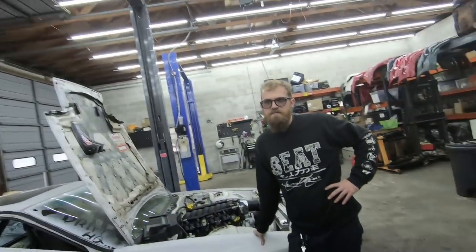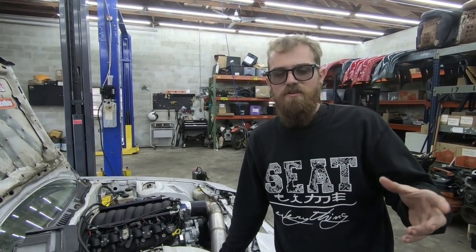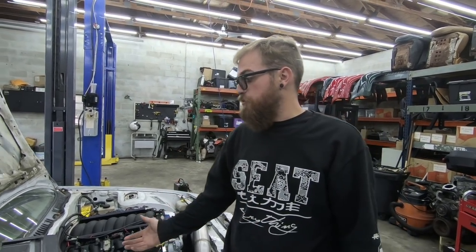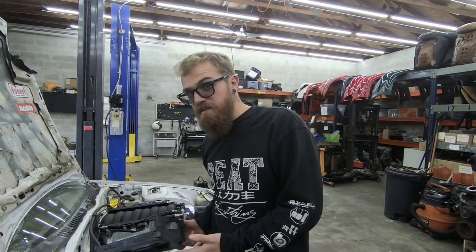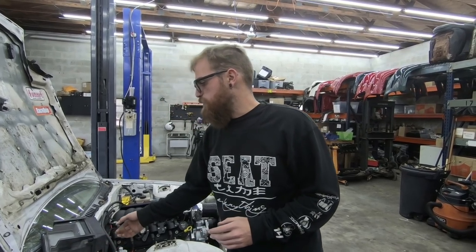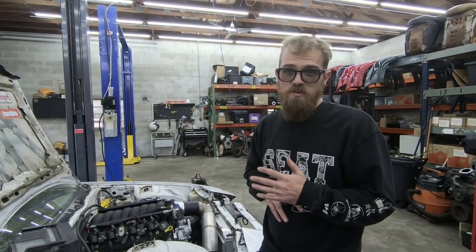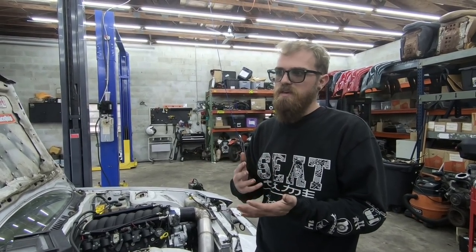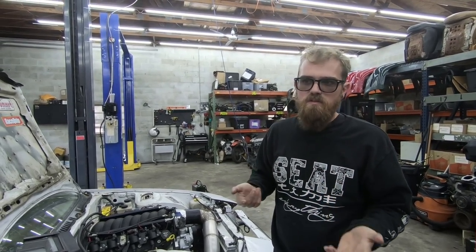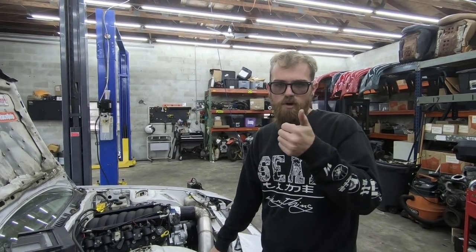That's mine. So what did we end up deciding? We got here and he was looking at Ben's car, which has a Holley Terminator in it. And I always try to steer people towards the stock ECU because you have the ECU, you have the wiring - you can do it somewhat cheap. But at a minimum you're going to spend $300 on a mediocre conversion harness, then $500 on HP Tuners, and you still need a wideband, coolant temp, and oil pressure gauge. So at a minimum to have it right you're going to spend $1,100 to $1,300, or you can buy the Terminator for right at $1,000 and you get a wideband with it.